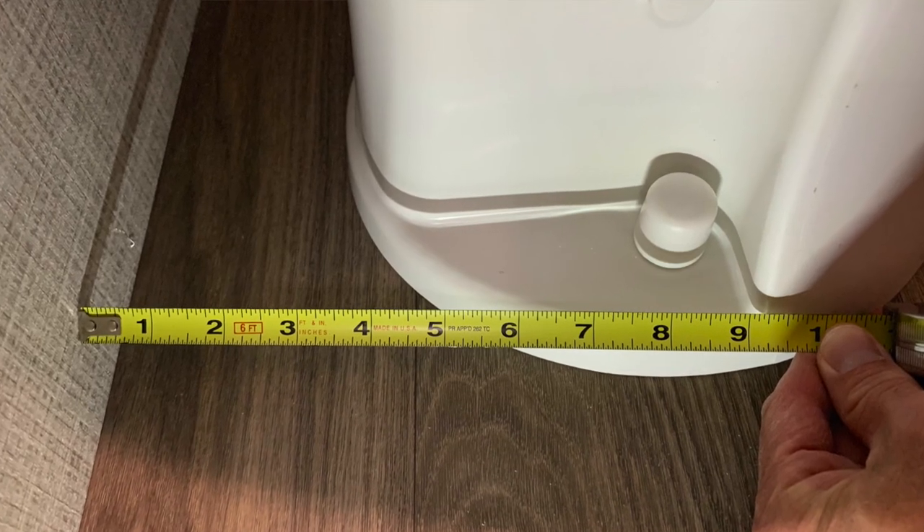Dometic immediately offered to upgrade us to a 310 series toilet for $50 — not the 300. They also offered a $75 deal for a ceramic bowl which would include a wooden seat. Unfortunately, this option does not work on the 243BHS due to the larger clearance needed from the T-bolts to the rear wall. The Model 300 toilet only requires 8.5 inches, which we have, but the Model 310 requires 10 inches — so we couldn't use the 310 in the Bullet. We received a warranty authorization PDF through email from Dometic the same day.